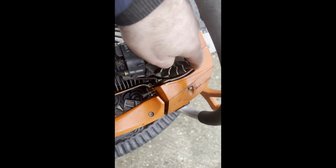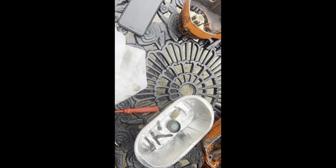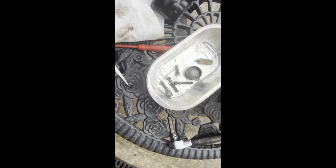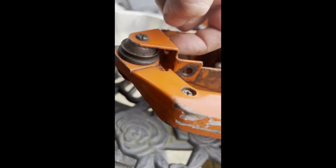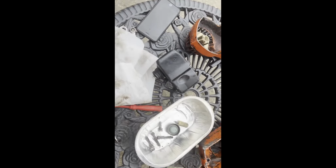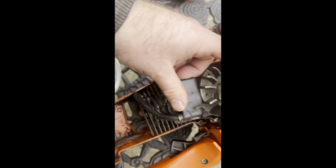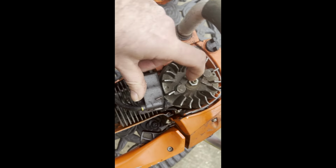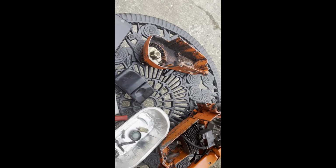Right, so there's two bolts through the front, a bolt through the back, and there was a nut and bolt. There's a pinch bolt there because it can do a little bit of a pirouette. I've wriggled the tank out, got the main gear weight at the bottom, and there is the hole for the fuel line. And that's it, pointing out, sneaks through there, runs up the handle and into our carburetor. So I'm going to run a bit of line in, and I'm going to clean that. I am going to put some oil on these and a bit of a clean to help them spring back. That one springs, that one not so keen. So I'll get that cleaned up and we'll be back.